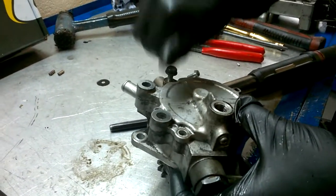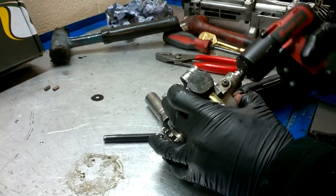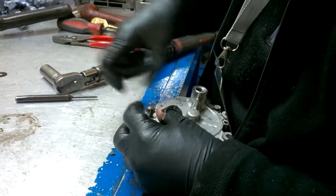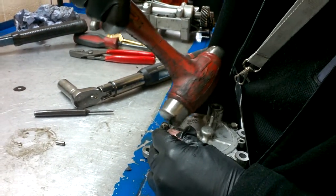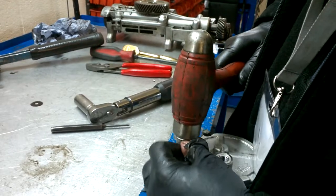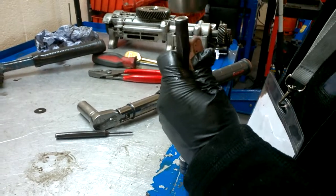So, you need to fit your three 10mm bolts. It's absolutely imperative that you get these back in there — these keep this unit sealed. Make sure you do it nice and straight, otherwise you'll easily break the casting. Use a punch to send it all the way down.